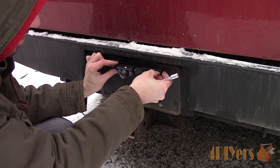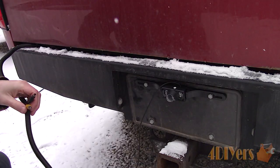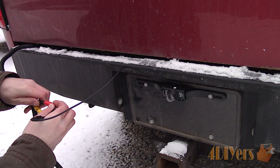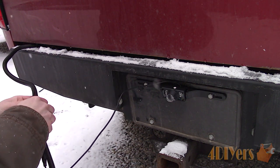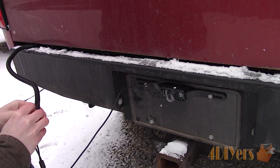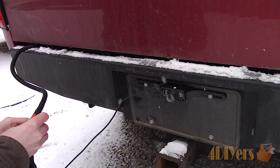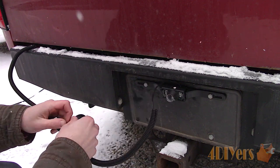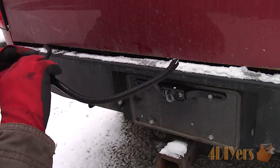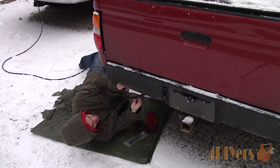Install the backup camera into place. Unlike the other version I installed with fasteners on the license plate cover, this one just bolts up using the license plate mounting holes — just make sure those fasteners are long enough. Plug in the power and video wires, then install the split loop casing. Mine is a smaller diameter so one connection was installed in one section and an additional section for the other connector. Everything was closed up using electrical tape, and finally the wires were pushed back into place behind the bumper. I used cable ties to hold it all together keeping the wiring safe and clean.